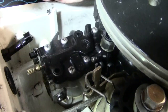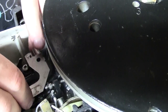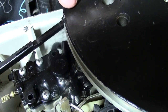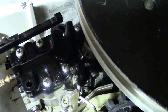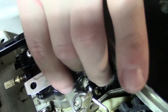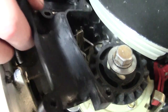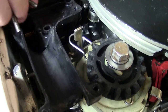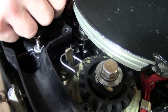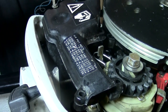Place the L-shaped plate back on, which helps guide the choke. Put the choke back through the hole and make sure it fits in the slot on the part that comes off the top plate. Next, take the bottom part of the air bonnet and put it in place with the two screws you originally took out. Then take the top part of the air bonnet, put it in place, and put in the four screws that hold it.